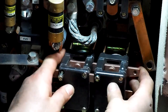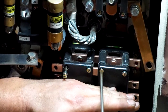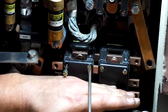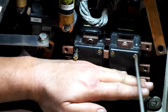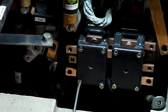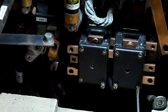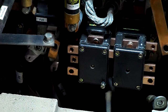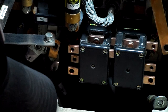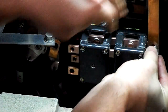Here we are installing the contactor assembly. You might have to shake it around to seat the plungers. Secure all the screws, but you don't have to make them really tight — you need some space to get those collars in. Just set it in. Some of these may not line up, just shake them around and try to guide them in. Line up your link — this is movable, it does go up and down, just for the height of the other contactor.